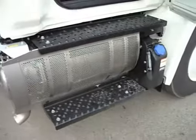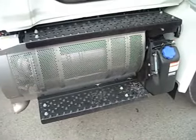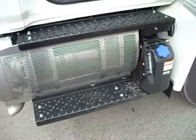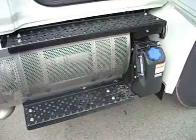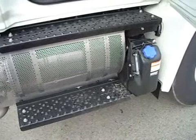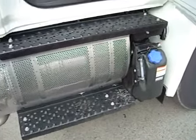So here's your SCR equipment with a 4.7 DEF tank that is mounted on the passenger side. Rule of thumb for SCR, it's 50 to 1. Just remember, if you're going to consume 50 gallons of fuel, you'll use 1 gallon of the DEF fluid / urea, now on the 2011 model years.